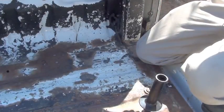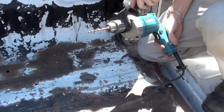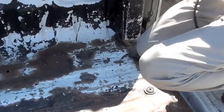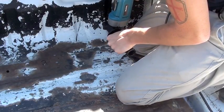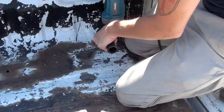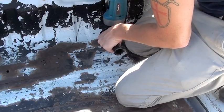I'm going to go ahead and drill out the marked holes I have in the bed for the second D-ring. I'm starting out with a smaller drill bit and I'm going to work my way up to the larger drill bit, just to help the larger bit not wander when it goes in. You could use a center punch, but I find that with relatively thin metal like a truck box, on a flat surface like this, I don't really need one to get lined up right.